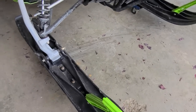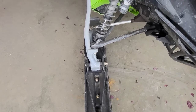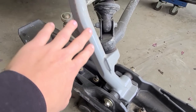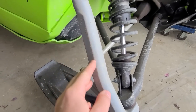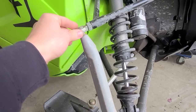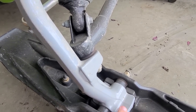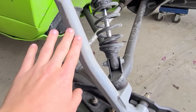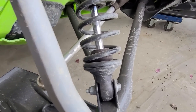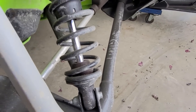Starting at the ski, we're checking that it's not obviously bent. In a lot of cases you can bend plastic skis back into shape, but this one looks nice and straight. If it has a powder-coated spindle — this piece right here — look for any signs of obvious cracking in the powder coating, because that could indicate the spindle is bent. Not all spindles are powder coated, so on bare aluminum spindles just look for any signs of stress.